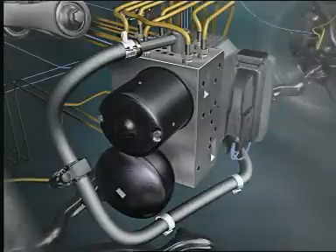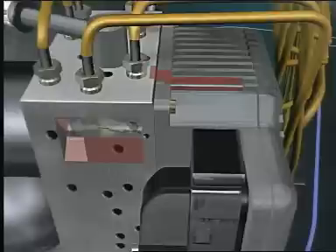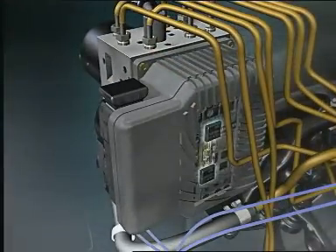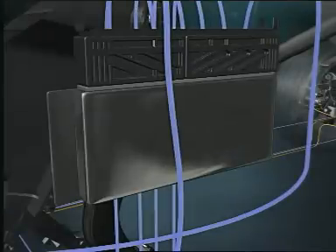The central control unit of SBC is an efficient component integrating the pump motor, the high-pressure reservoir, the hydraulic valves, the pressure sensors, and the SBC microcomputer. For optimal brake intervention, the SBC computer is also connected to the control unit of the electronic stability program, ESP.